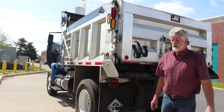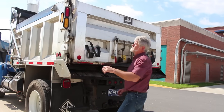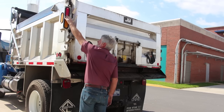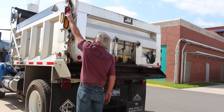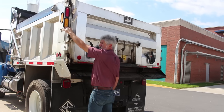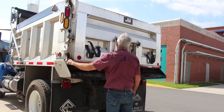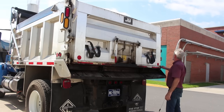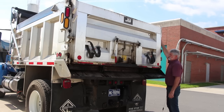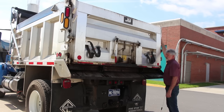Moving on to the rear of the truck: the tailgate's general condition looks good. Starting with the lights — the red brake light, tail light, and clearance light are proper color, securely mounted, not cracked, bent, or broken, and there is a clear backup light in this light. Directly below is an amber strobe light — clean and clear, securely mounted, not cracked, bent, or broken. The tailgate latches are securely mounted, not cracked, bent, or broken. Coming across the top: the far-side red tail light, brake light, and four-way clearance light are securely mounted — it also has a backup light in it. Below that is an amber-colored strobe light — clean and clear, securely mounted, not cracked, bent, or broken.